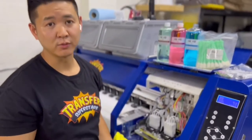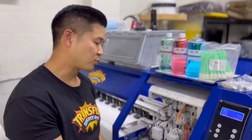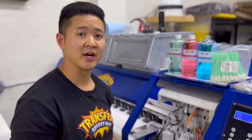Now if that doesn't work, what you're gonna be doing next is called a printhead flush or a waterfall, and that's where you're gonna be taking out the dampers and actually running the solution through it. I'm gonna be showing you guys that next.